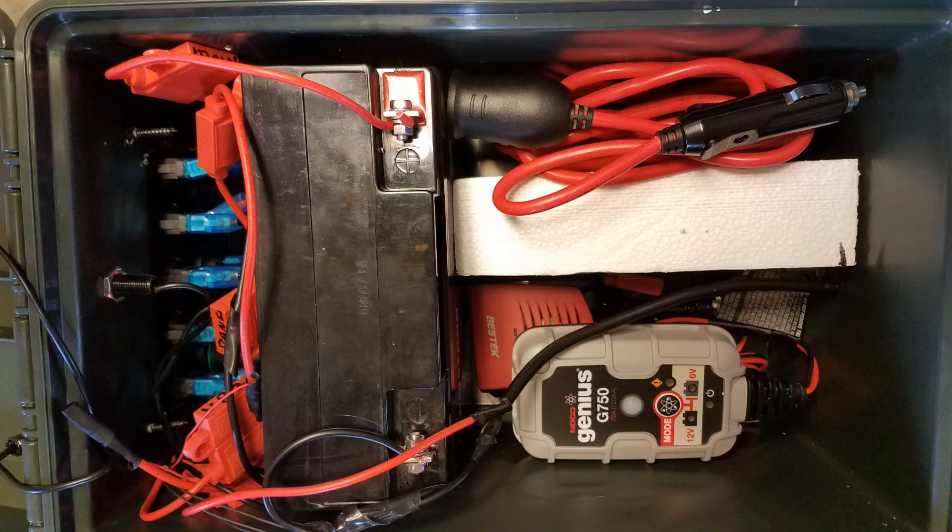Ultimately I'm going to wire in pigtails with eyelets to the battery positive and negative for all of the hot wires, the grounds, and the battery charger. This trickle charger from Genius — I've got one in my motor home, a little bit bigger one, and I really like them. You can leave them connected up all the time and they will maintain your battery at a full charge. All automatic, no back feed, no reverse connections. I'll have a link in the description.